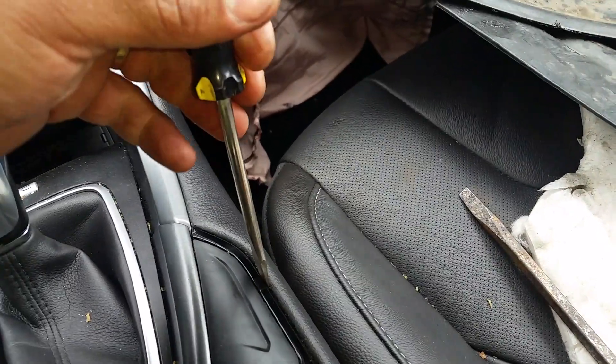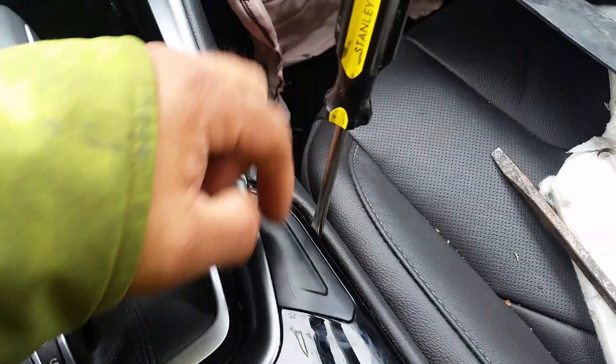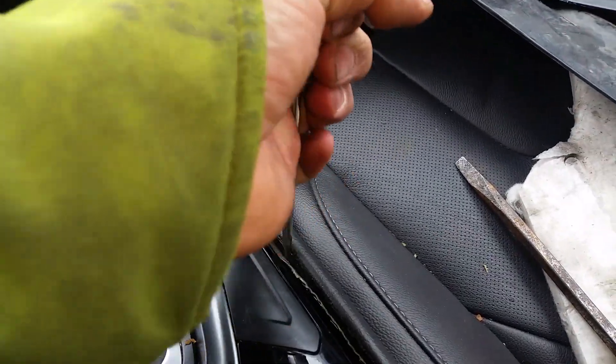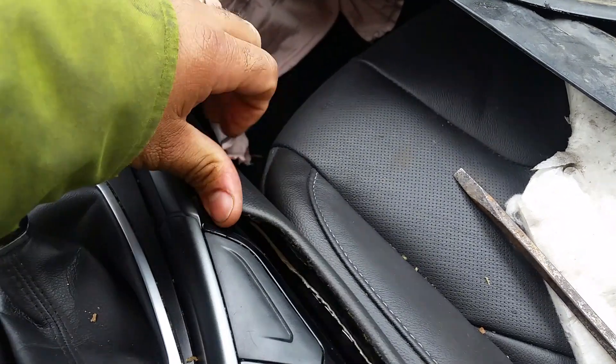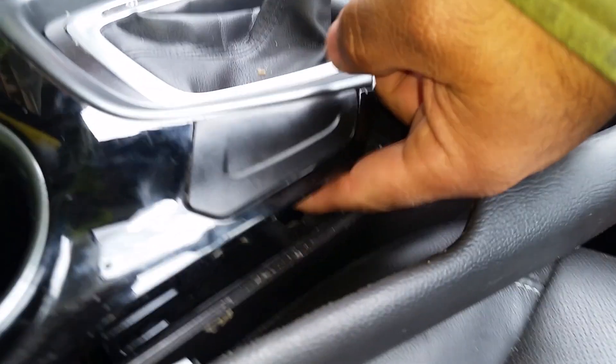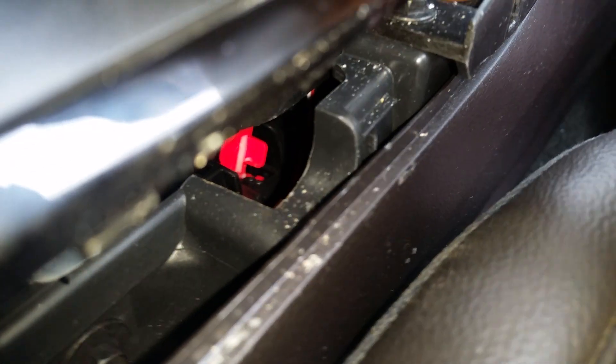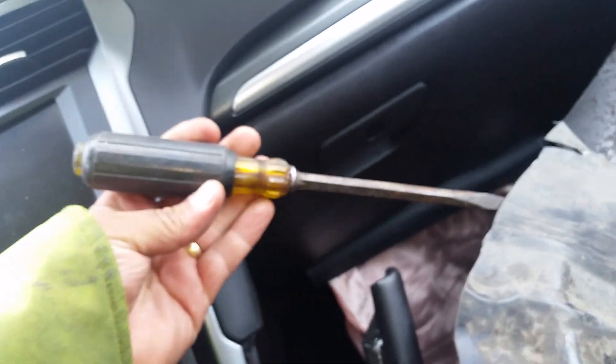2016 Ford Fusion — this panel comes out. You just put a screwdriver, make sure you don't push against the plastic, push it to the side. Pop it out of place and then push the end out. Once you get to the side there's a cutout right here, and you can see — with the camera and the light on — you see that tab. You want to take it and push it forward, but you're going to need a long screwdriver because a little screwdriver doesn't reach.